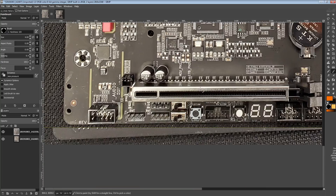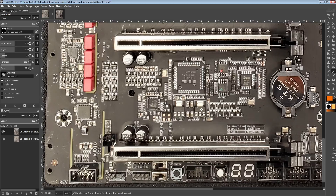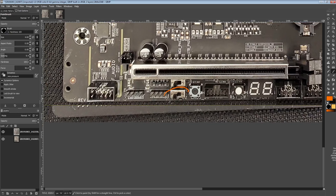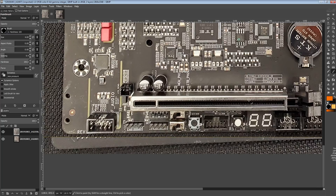Because it's a dual BIOS board from Gigabyte, they have an automatic dual BIOS system that, in my opinion, is completely stupid. If you're doing overclocking with memory or anything, you might not post several times in a row, and it'll just randomly decide to throw you onto the other BIOS chip — not even the backup one, just whichever one isn't currently in use. The annoying thing is your BIOS profiles are tied to the BIOS chip they're saved on. Gigabyte gives you a single BIOS mode switch so you can put the board into single BIOS mode where it won't automatically jump. One of the switches lets you manually select if you're on the main chip or the backup chip.